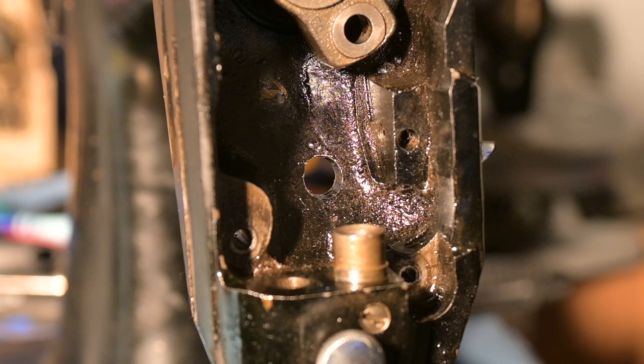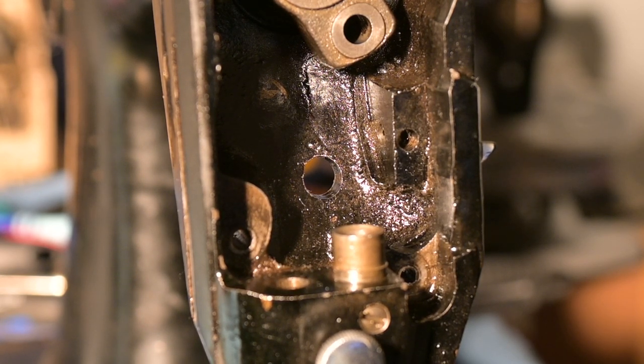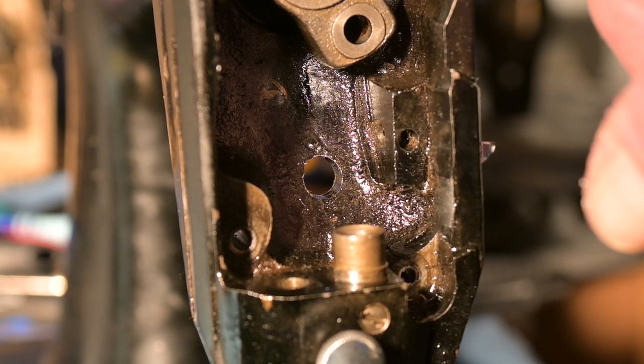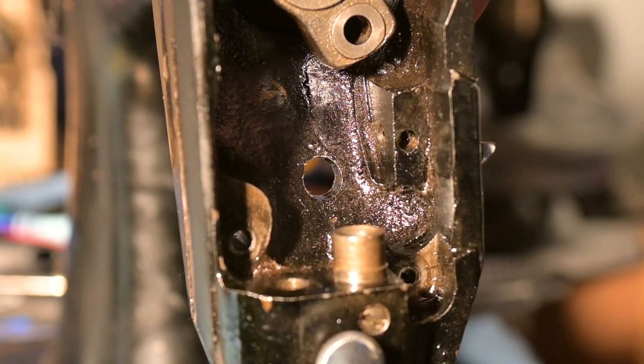Well, here we are at this unexpected finish, and I haven't replaced the clean presser bar. Actually, I've emptied everything out of the front end here, and the only thing that's left is the counterweight, which I cannot remove because of a stuck set screw. So I have to make a decision. Do I continue and remove this? If I want to remove this, I have to remove the whole horizontal arm shaft.